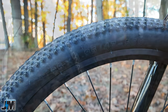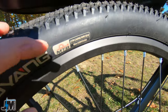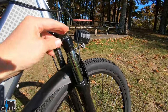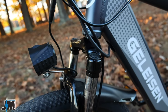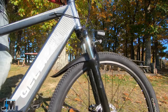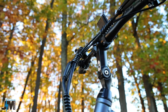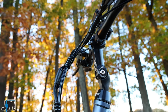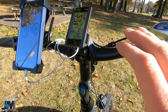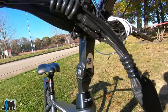For tires, this bike is sitting on a pair of 26x1.95 Chaoyang MTB 27 TPI wire bead 68A compound tires — pretty decent knobby tires for the bike. There is a front suspension, but no adjustability for preload or lockout — it's a pretty cheap front suspension, but it does soften the ride. One thing I was really excited to see is the adjustable gooseneck, which is usually an add-on option costing at least $30. It's 31.8mm and you can adjust it forward for taller riders or back for shorter riders. Really nice to see that included.